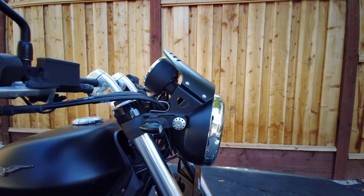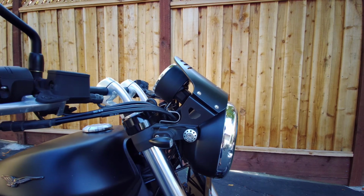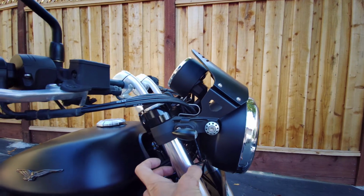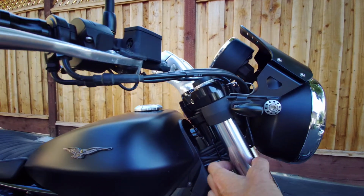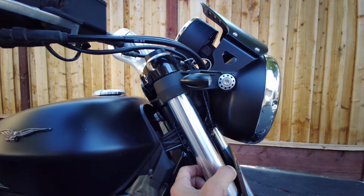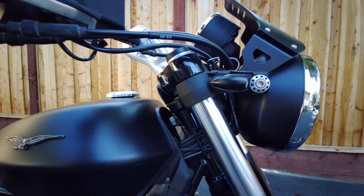And you could just use a PVC pipe, the white water irrigation pipe that you get at Home Depot, at the hardware store. And I'm guessing probably a 1-inch pipe will fit in here. So just eyeballing the outside diameter, I think the outside diameter here is 40 millimeters or 41 millimeters. So the inside should be able to fit a 1-inch pipe.